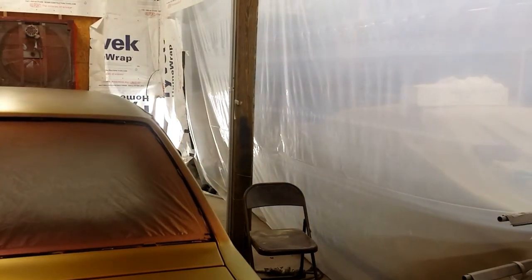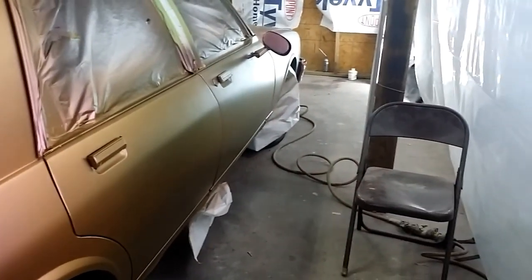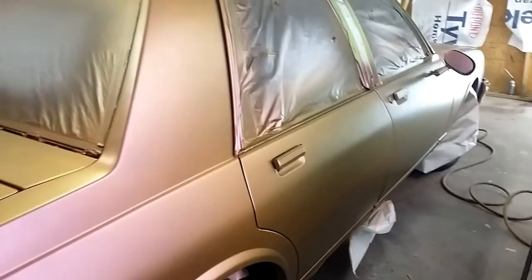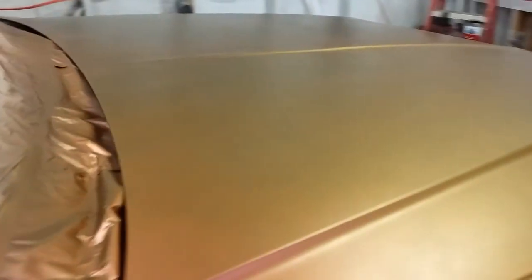See a little plastic barrier in my shop. Usually I don't even put a barrier up, man. I just spray. And I done had the cleanest jobs come out with everything showing and a whole bunch of junk around in here. But the main thing is to make sure your floor is wet, man, and you're putting that clear down. You probably slide away, getting away with it, you know what I'm saying, with just your base. When you put that clear down, put something on the floor, man, so it won't kick up that dust to your job. Make sure you tack your job off too, man.